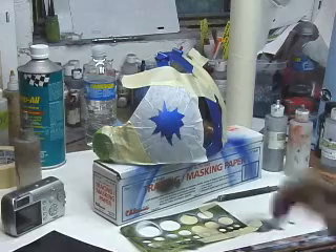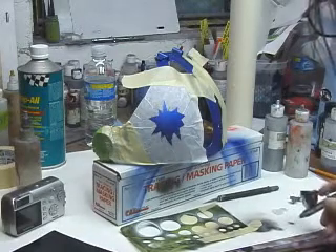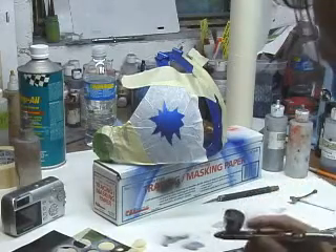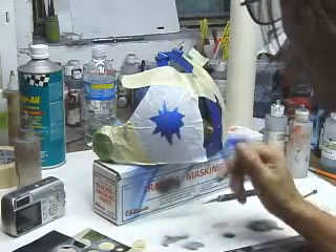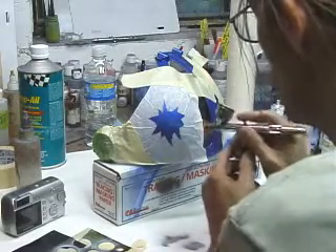So to this point, we're ready to apply our base color. Our base color is going to be House of Color orange silver. You always want to test your airbrush before you use it. Whenever airbrushing a stencil or a template, you always want to airbrush away from the edges, into the middle.